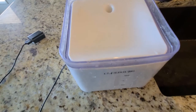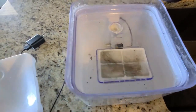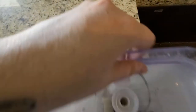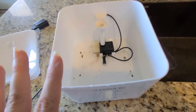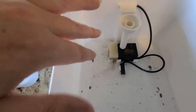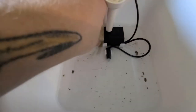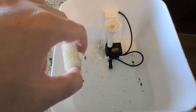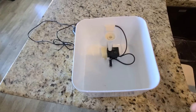I already emptied the water and it's really easy to disassemble and clean. This part just pops out, then this whole tray here is your filter — you can see the cat hair; it's really doing its job — so we'll replace that filter as well. Then this whole plastic piece pops out and you can clean it. Note that this one should not go in the dishwasher — it is not dishwasher safe. There's a little sponge that actually picks up most of the cat hair and debris so it doesn't get into the pump.